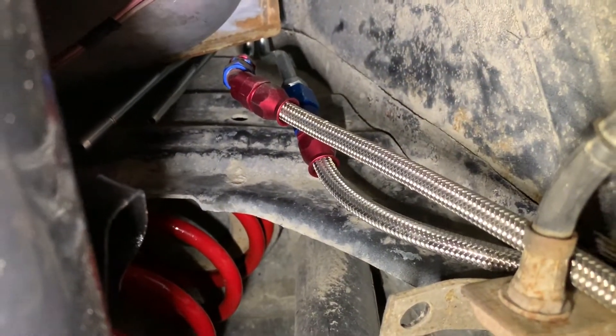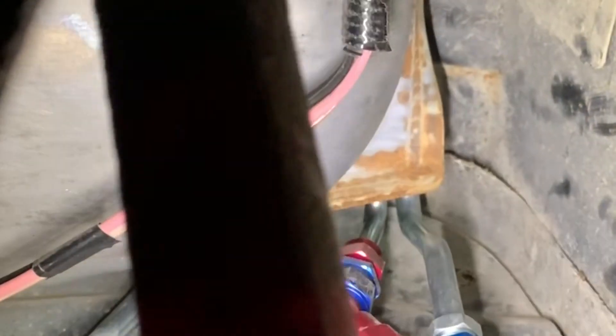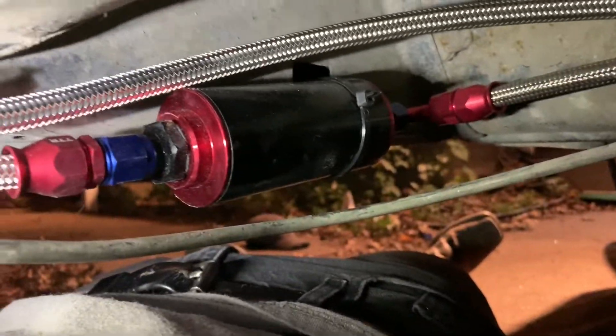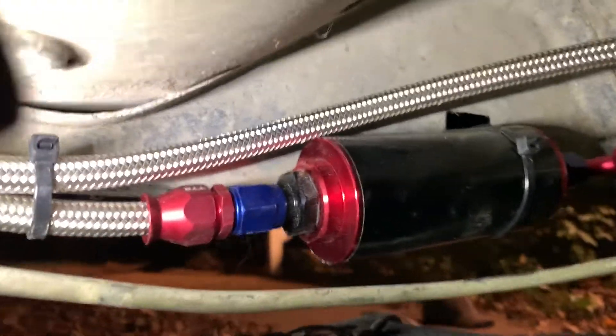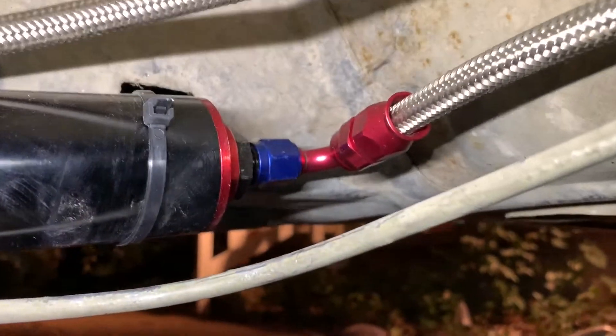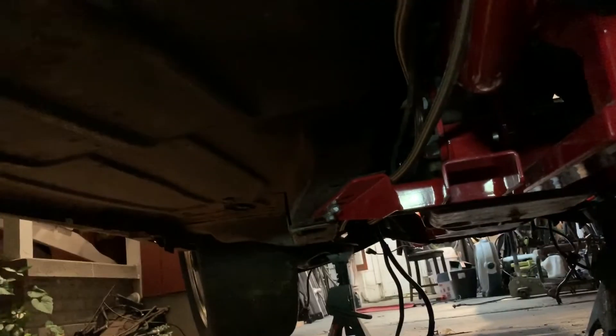Alright, here's what we got underneath the car. Up here is the sending unit with the supply line and fitting going into a connector. Then we've got the tube line with the collar crimped onto it going down to the return. Tracing down — there's the fuel filter, an Evil Energy 50-micron, 100-micron filter with a straight 6AN end going in. This filter comes with 6AN, 8AN, and 10AN ends so you can upgrade your fuel line later and still use it. Then there's a 90-degree fitting going down underneath the crossmember for the transmission and up to the intake.